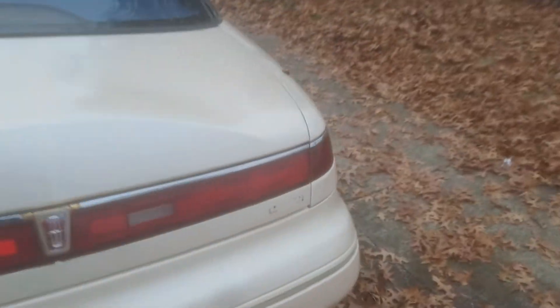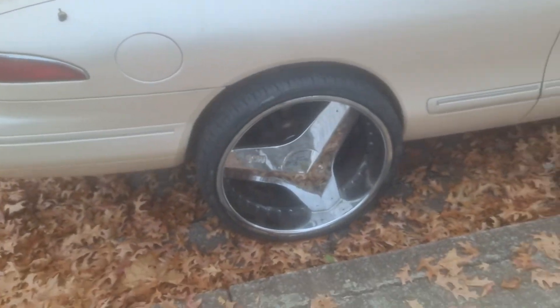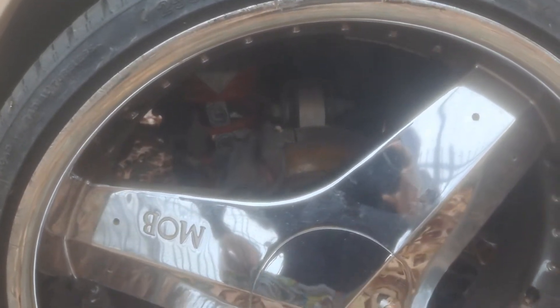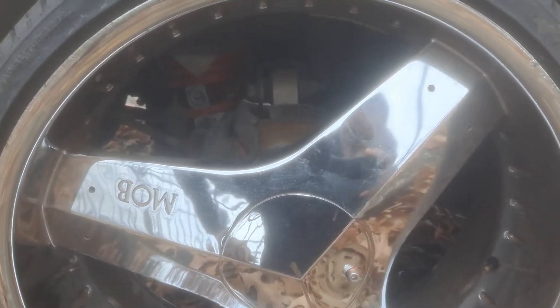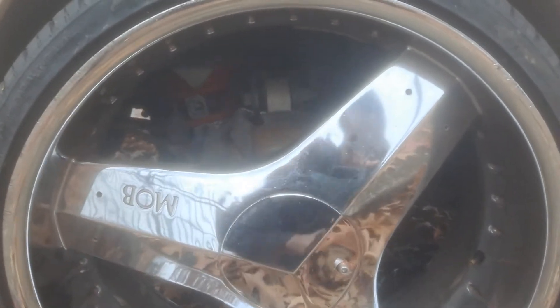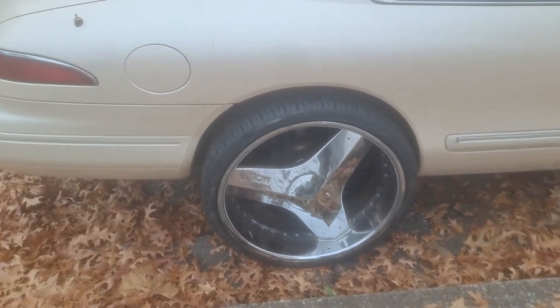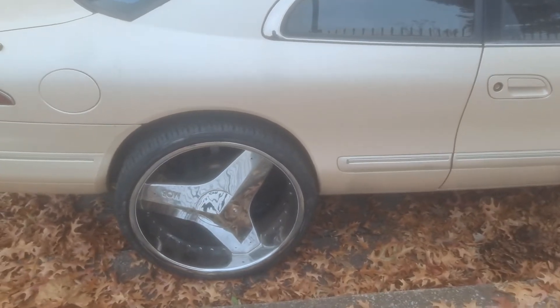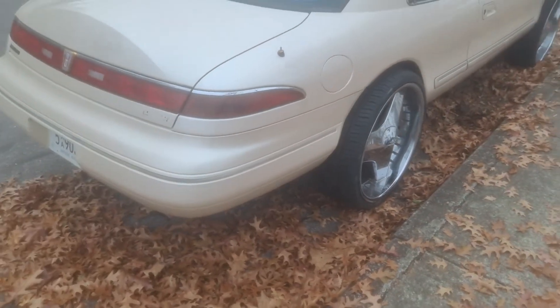Now this back I could raise up a little bit more. I'm gonna try and look for some springs so I can raise the back up some more. Right now that's what we got in there, so we're gonna change that out and see if we can find some taller coil springs to push it up some. We just got knuckles in here for now — you guys know I like to do natural lifts when I do these cars. I'm gonna be looking for some springs from a truck and see if I can get the truck springs in here, that way it'll sit up a little bit higher, similar to the rest of these guys.